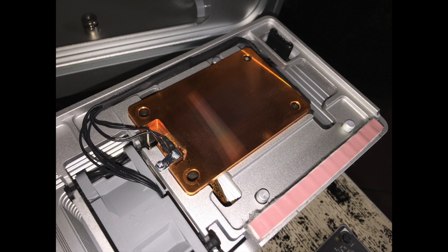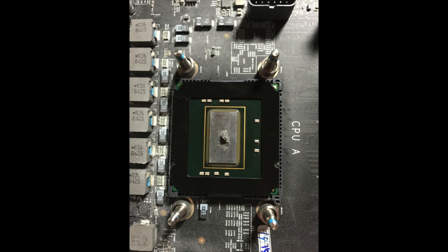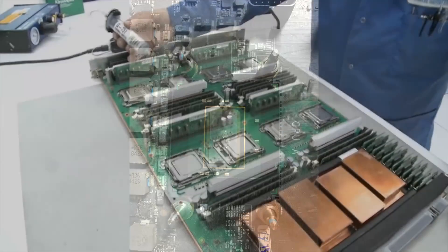Here is a CPU — this is the 5690 that I installed. Notice I put a pea-sized piece of thermal paste on there. That black area surrounding the CPU is just a little holder. You'll put the CPU on, then the black part. Those bolts around the edges are where you put the hex screw in and unscrew it — that's where they become disconnected.